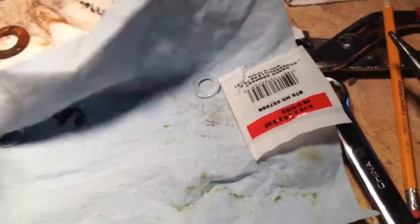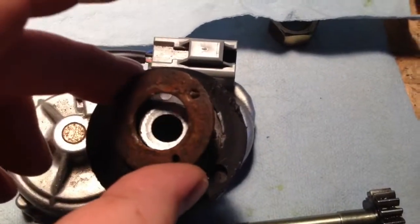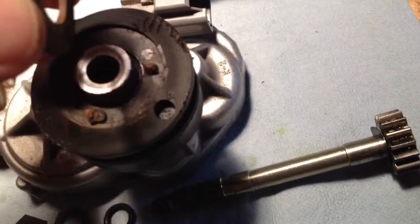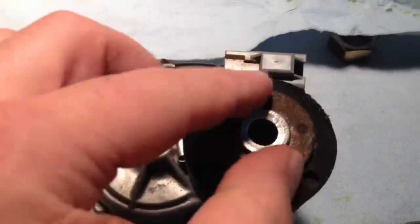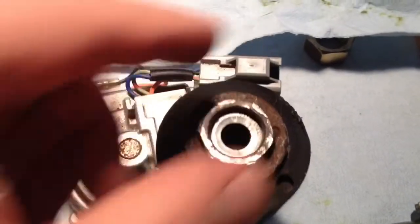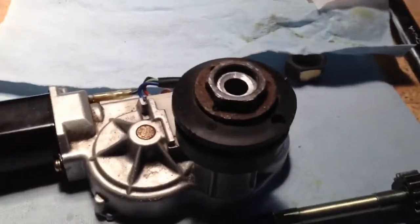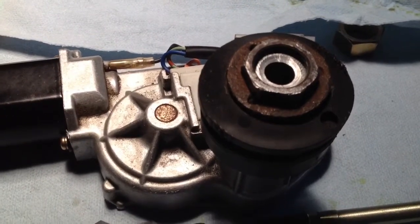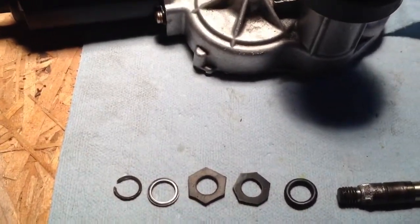Right here. And the metal washer, which is for the jam nut to hit against. I don't know if maybe I'll hunt down a new washer. I'll reuse that one, but that goes on. Then my jam nut. So that'll be my stack up back through the door, and then I'm sure it'll work. It'll just be a matter of how good my stack up seals out the water.